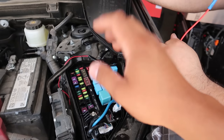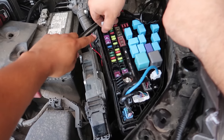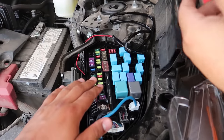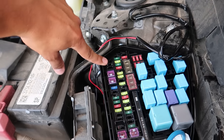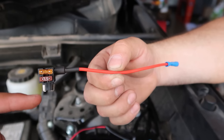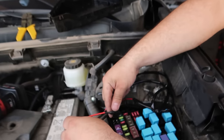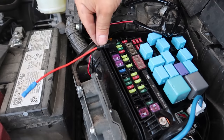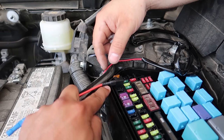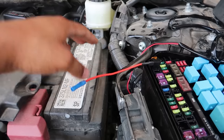Now that we're at the fuse box — looking on the actual box you'll see the fuse puller you'll need to remove the fuse. The fuse we're gonna be tapping into is the 7.5 amp fuse. Here's the headlight, and looking way back at the fuse box it should be the top one that says 7.5. Grab the add-a-fuse — the 7.5 fuse we removed goes into the slot closest to the open end, which goes back into the fuse box. At the top we put a 5 amp fuse, then reinstall it just like that. We're also going to trim the wire slightly so the fuse box cover can close again, and then crimp down the power wire going to the harness.